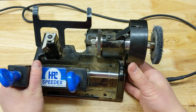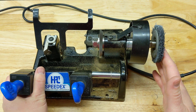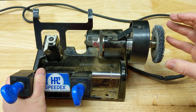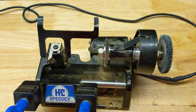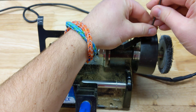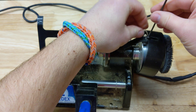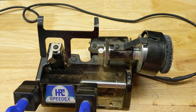Now, this is to release this whole plastic shield. You can take off the deburring brush and take it out completely, but a lot of times we just want to replace it quickly, and that's what I'm going to show you how to do. So the first thing we'll do is remove this top 3/32nd Allen, just like that. We'll take it all the way off and set it aside, and then we'll get that bottom one.